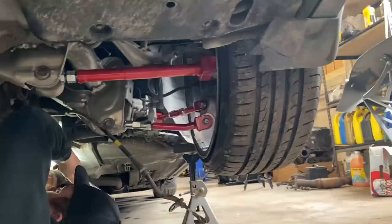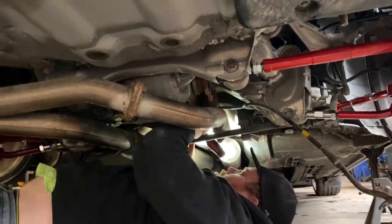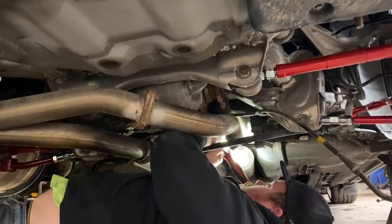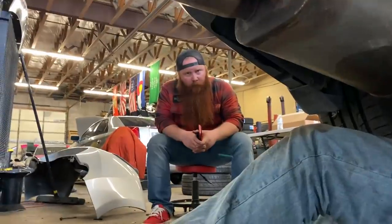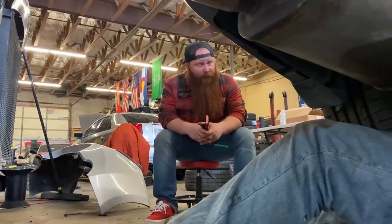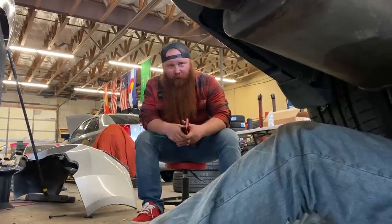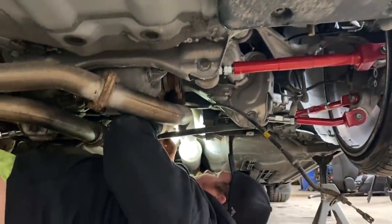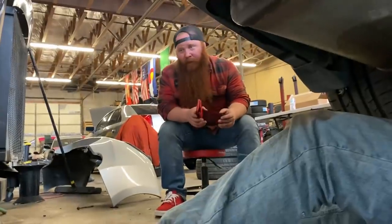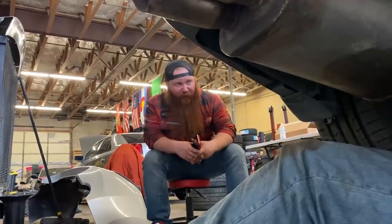For step two, we've got everything on the wheels done, we've left the axles out. While they're out, we're gonna drop that diff and do a little weldy-weldy — glue it together. How does the internet feel about gluing diffs? The internet's opinion doesn't matter — there's really no downside, you're saving a thousand bucks and it doesn't take that long. Those guys did post that one rowdy video of them JB welding a diff in a Crown Vic — it worked for a while.